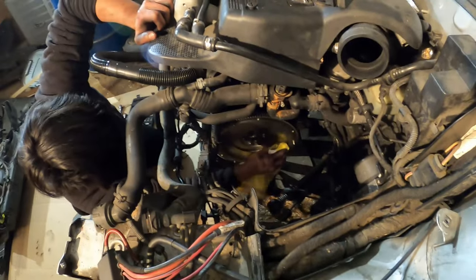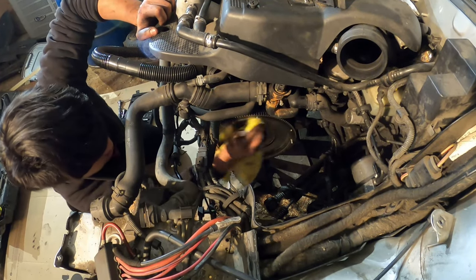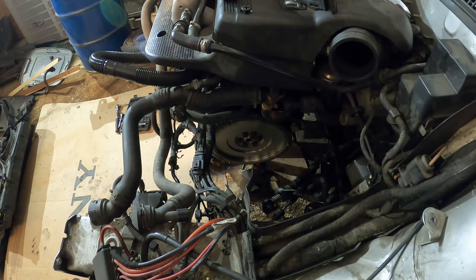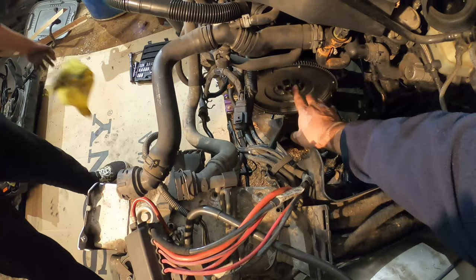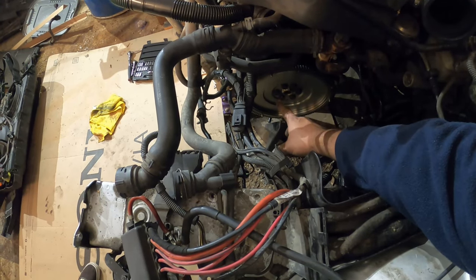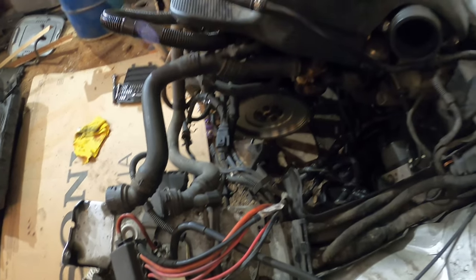Mark is now doing the final part. We had to use some carburetor cleaner or part cleaner to make sure that the surface is now grease-free, because he put his grubby hands all over the flywheel and you can't have any contaminants on the flywheel. So again, we torque down the flywheel bolts at 44 foot-pounds and then a quarter turn, and that's it. The next step is the clutch and then the pressure plate — the bolts that go around the pressure plate are at 15 foot-pounds. There you go. Good job.